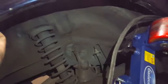Here's the final result for the passenger side. I didn't flare it out as much but it is a lot more consistent than the other side. I still have a little bit of a dimple right here that I will fix in the next couple of days. Now for the rear — if you look at this, it has this little lip. You're going to want to take that off first and then do the same process. Although the metal used in the back is a little thicker than the front, a reasonable amount that you'll have to heat it up a bit more and go in stages. Sometimes I've knocked it in with a hammer just ever so slightly just to get the roller started.